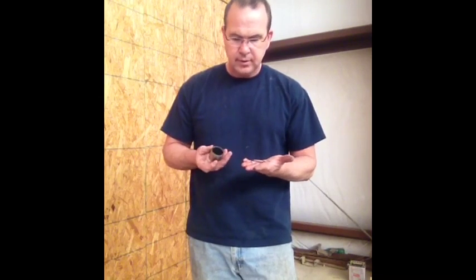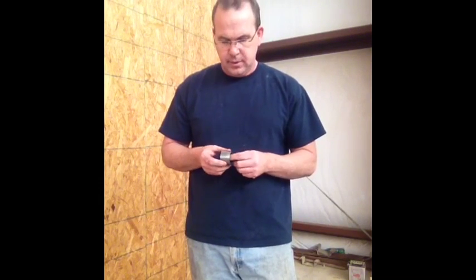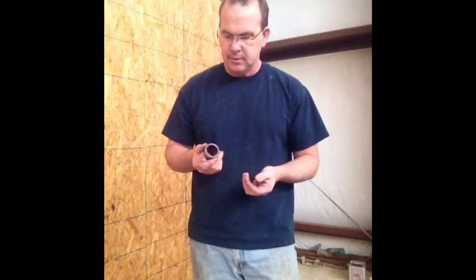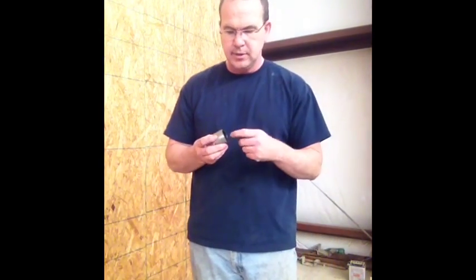So if you're going to replace your bearing, and I assume that's one of the main reasons you're watching this video, it gets you 2 new thrust washers. Maybe by the time some of you are reading this, we're selling this already. But anyway, if you're just cleaning, then clean the shaft off good too. And then like I said, you can put a light coat of grease back inside to get the excess off. You don't want grease outside of this.